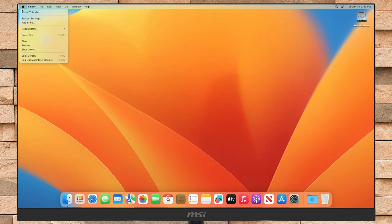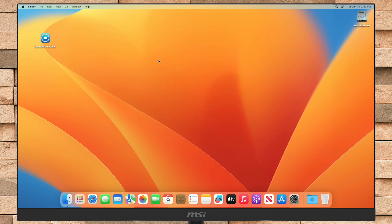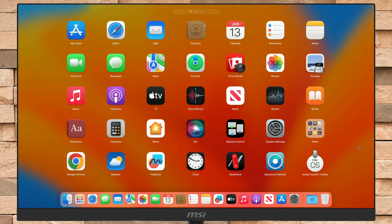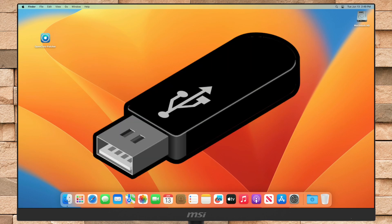For this guide, I'll be using a Mac Mini 2014 model, which is unsupported since macOS Ventura. For installing macOS Sonoma on unsupported hardware, you'll need the macOS Sonoma Installer. To download the installer for yourself, follow the guide from my button. Also, you'll need OpenCore Patcher, which you can download from the link in the video description, and a USB with a minimum 16 GB capacity is also required.